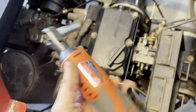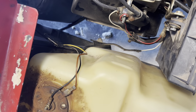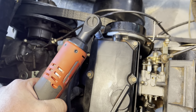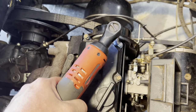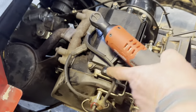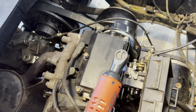I highly recommend one of these impacts — things are amazing. Put this thing on reverse. You have to lash the valves when they're cold, and I'll be honest, I lashed my valves while my motor was sitting on the bench — it was so much easier.